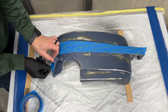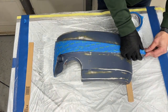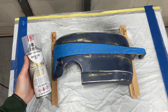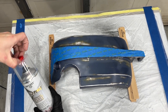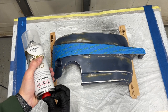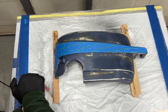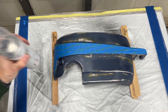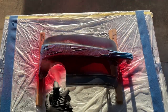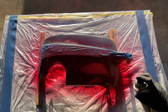Then I came through and taped off the areas of the cowl that I did not want to paint. I wanted to save that aluminum band that's there — keep that nice and clean. Did a really nice job sanding and prepping that, making sure we removed all the oxidation. Then we're going to take some Propoxy Vivid Red, another 2K aerosol. This is a very bright, very nice finish.